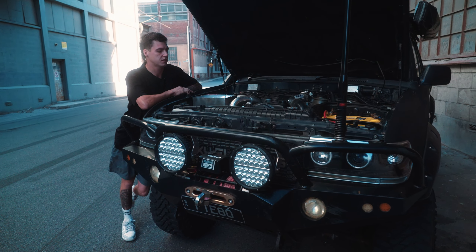As long as you do all the prep work, it's pretty easy paint to apply. I sanded the whole car back and used a wax and degrease remover, gave it a good clean, took off all the accessories, all the trims, mirrors — it was really just a bare body. This was a full closed-door respray. It's been on the car about five years now and hasn't faded or anything. It's very hard wearing — I've done a lot of big trips in this car, put it through trees and all of that, and it doesn't scratch or chip like normal paint would. That's one of the big things I really like about it — how tough and durable the paint is and how easy it was to do myself at home.